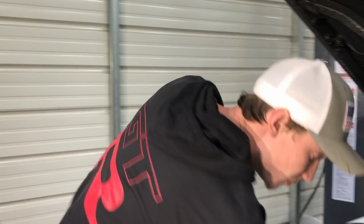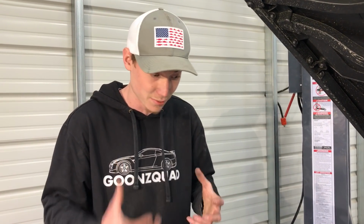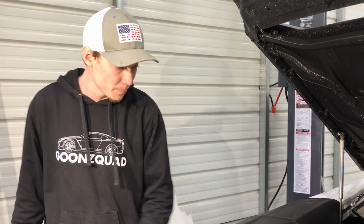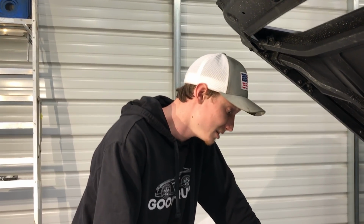All right, guys, so we just unbolted all the bolts off the starter, and we also unbolted the wire, the electrical components that go to the starter. We can't really remove the starter. We've been wiggling it around, and it's really tough to remove, honestly. It's in a very tight spot. Can't really get my hands around it to grip it well to pull it off. There are a few pins where the bolts were, so I'm thinking we're probably gonna have to take apart this whole entire rear end, the rear bumper, the exhaust, all this stuff, and probably this sump right here. So we're probably gonna be doing some kind of oil change. Yes, for sure. It's a lot of work, guys, just to get a starter off, but that's the way you got to do it, just to get this thing started. Honestly, that's our only option.